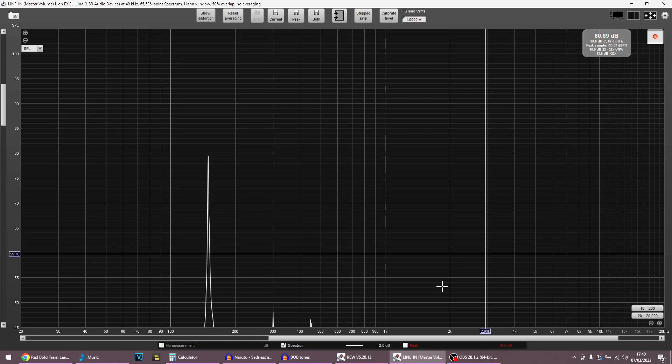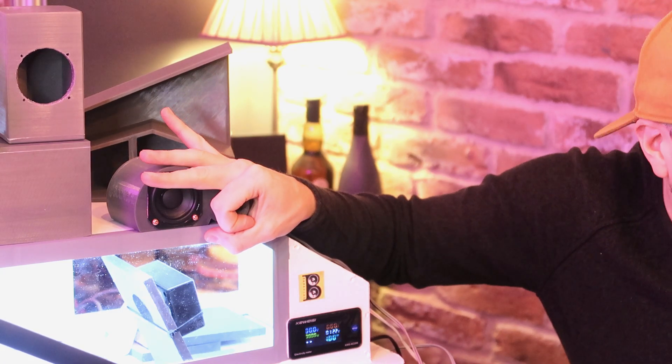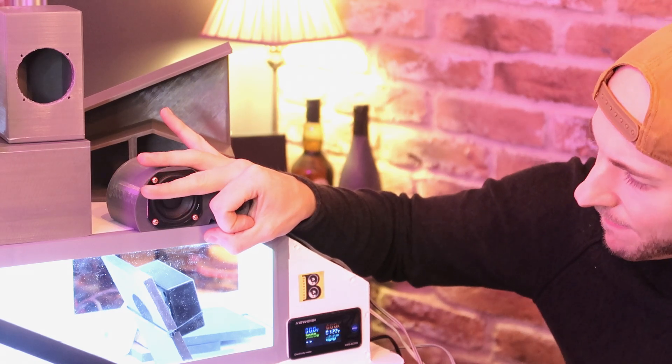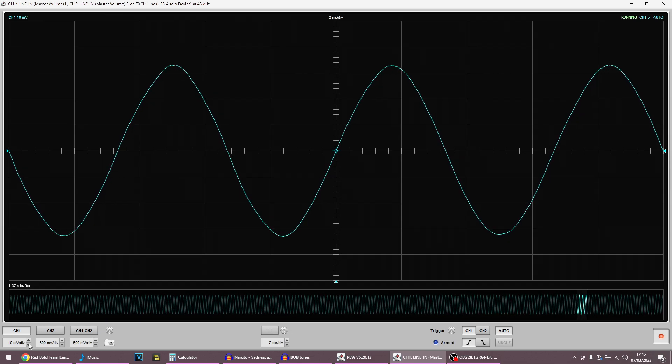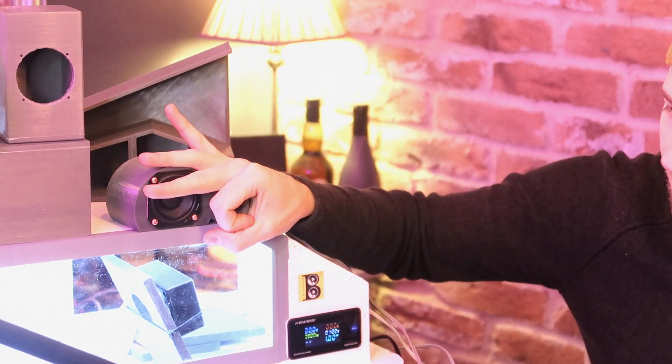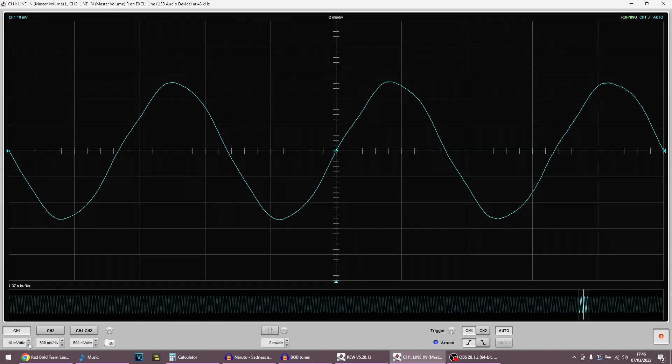That 750–780 Hz is definitely something to do with the port resonating. What's even more interesting is if I put my finger around the port to extend it a little bit, it actually cleans up the sine wave even further. So I think the resonating harmonic is going on in that last little bit of the port — the last little tube coming off the smaller chamber. By putting my finger there I'm extending the length of that, therefore changing the frequency that this harmonic occurs. With the science out of the way, let's throw it in the test cabin and run some bassy tracks to see how it actually sounds.